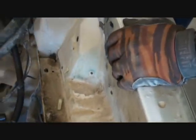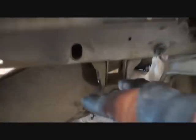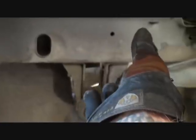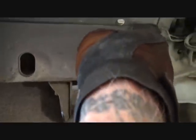By the time I get these spot welds out, and then I cut this right here, because, see the sway bar down here? Okay, well, yours got hit so hard, this bolt completely ripped out. This one's still there, but this frame structure here is rotten. So I'll cut it off right here. Okay, actually, I'm going to cut this one back here. On your car, I'm going to cut it here, because I want this to overlap, dude.